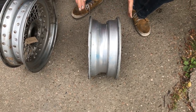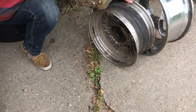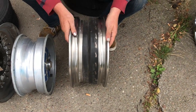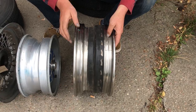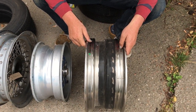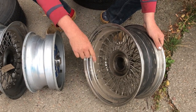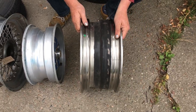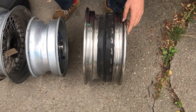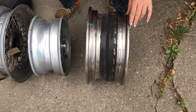Although this wheel is of the period where tubeless tyres were becoming prevalent, here is a wire wheel that claims to be tubeless. This is off a Morgan. We took it off the Morgan because it was failing — there was air coming out through the spoke holes around there. This is something we've come across every now and again. So we are just not advocates of running any wire wheels without tubes. Stick a tube in — when in doubt, put a tube in.